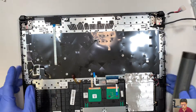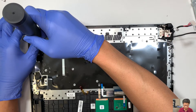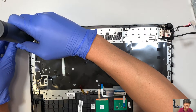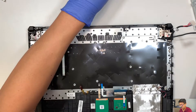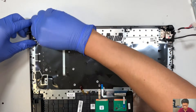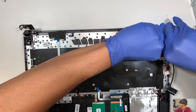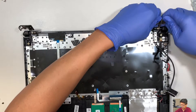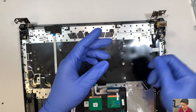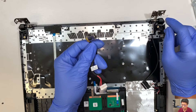The next step I'd like to talk about is the keyboard and the DC jack. Two screws are holding down to the hinge. What I like to do is to lift the thing up — same thing, apply on this side of the hinge. So again, coming back to the DC jack — if you broke your DC jack and you want to change it out, that's how you do it. Remove the screw, open up the hinge, and that's how the DC jack would come straight up.